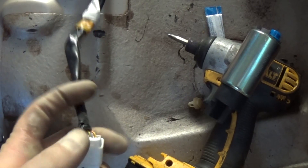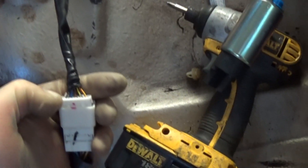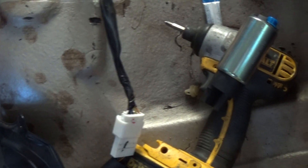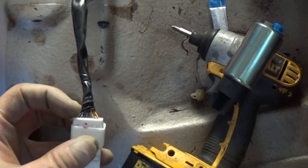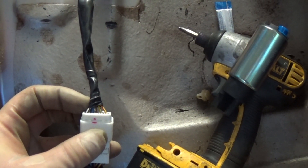It's pretty easy to get to. We have five wires on this connector - sometimes four, sometimes five. Two thick wires are power and ground to our fuel pump, since they carry more current. The other three wires are for the potentiometer - the fuel level position sensor.